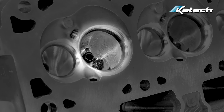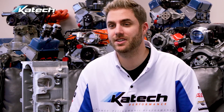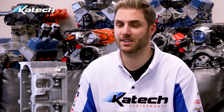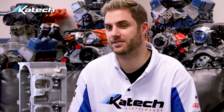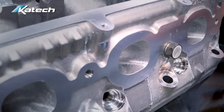There is what I think is a marketing term — fully ported cylinder heads — meaning that the CNC tool touched every portion of the port. The truth is you want to port strategically where it matters. And if you overport, it can actually do more harm than good. We see a lot of casting shift in production heads and you may see some areas where the CNC tool did not touch the port. That means the port is already larger than the math data provides, so the tool passes right over that portion of the head.